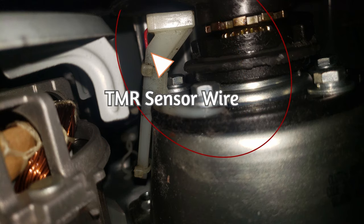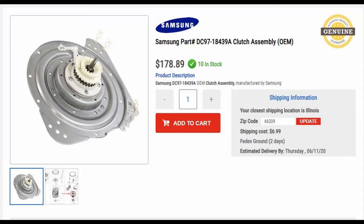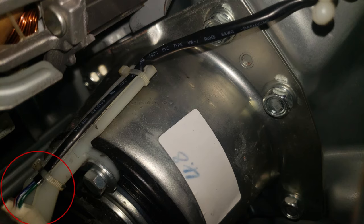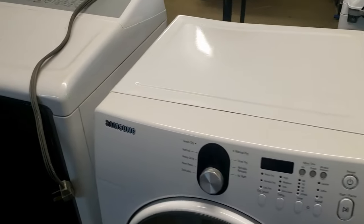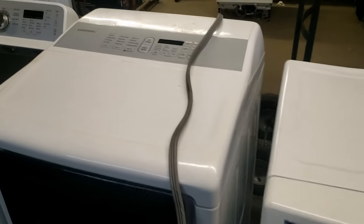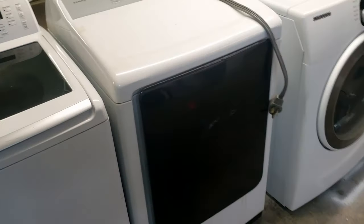We had to remove all the components on the motor assembly, take the plastic piece off via two screws, then solder the wires back onto the sensor. The TMR sensor is not sold by Samsung unfortunately, so your only option is to solder it or buy the entire shifting assembly. Once the wire was repaired, we were able to run the unit with zero problems and it spun immediately on the test run. There was a lot of slack on the wire harness so it wasn't extremely difficult to fix — other than removing the molex harness and soldering. You could use a molex plug remover, but we used tweezers.